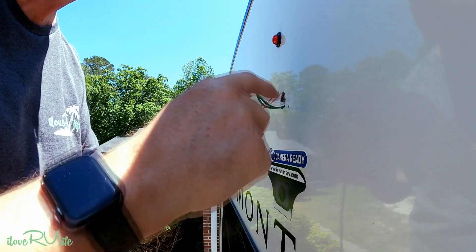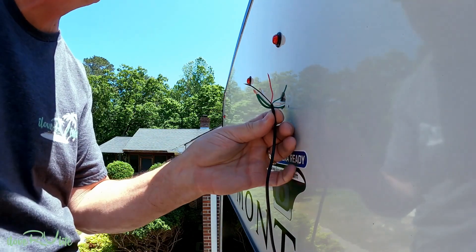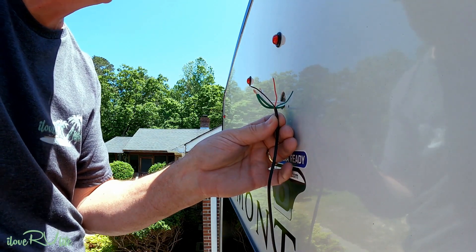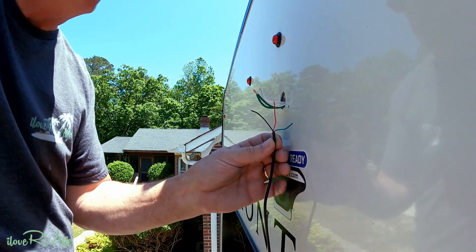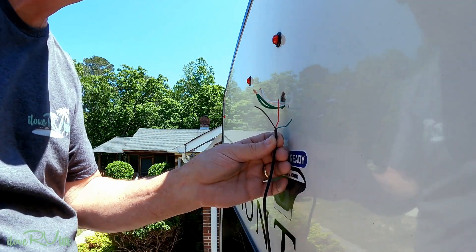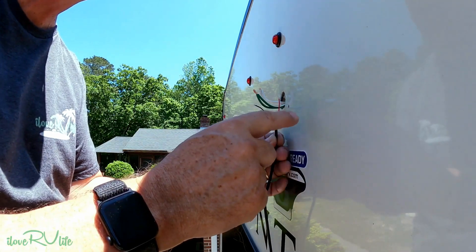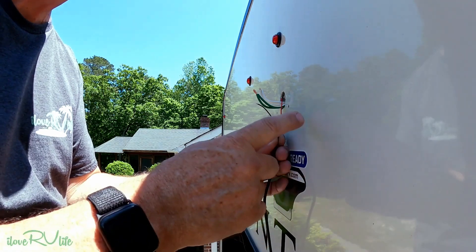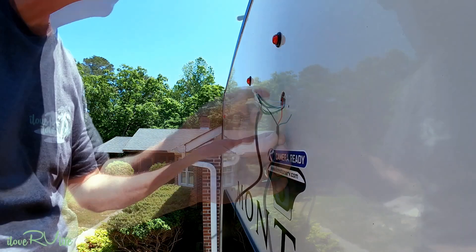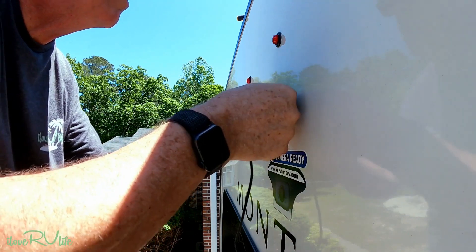My positive is white-green stripe and negative is the white wire. For wiring: red is positive, black is ground, and there's also a trigger wire. This camera has installations for other setups — like a big rig — where you can trigger the camera on and off with a separate switch by applying 12 volts positive to the trigger wire.